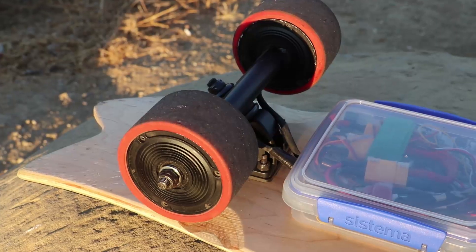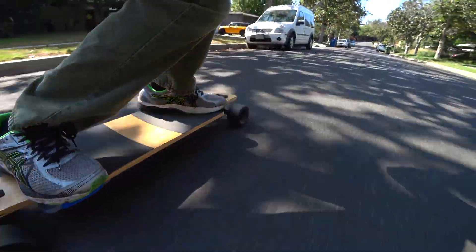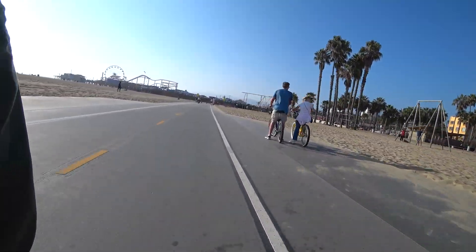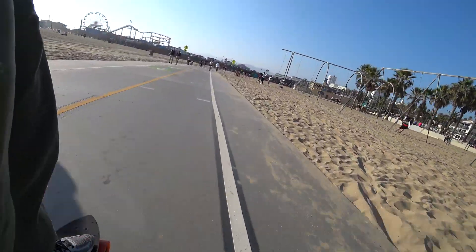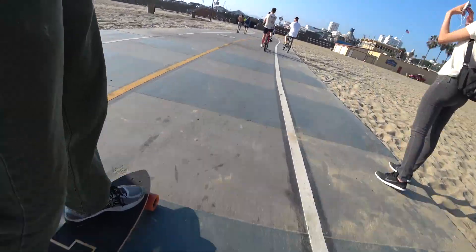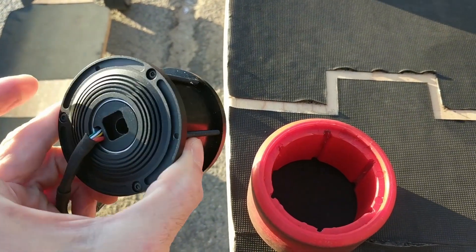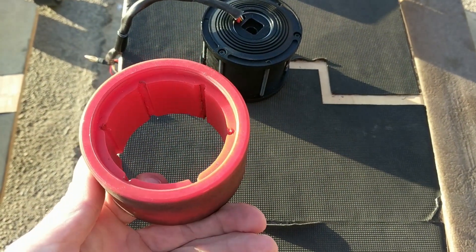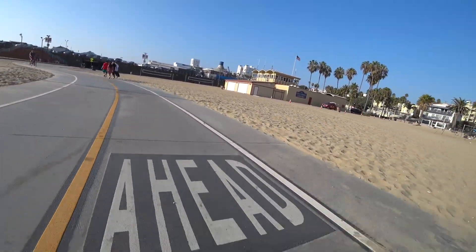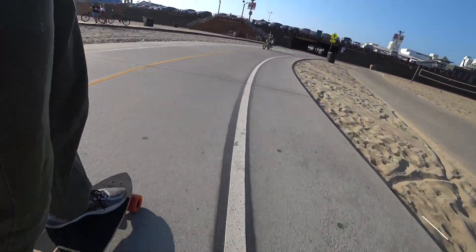There is definitely room for improvement. These motors are light, but they do struggle a bit on steep hills and tend to heat up. After riding my 10S longboard with the 90mm motors, it does make me think twice about an upgrade. I'm not sure I'd recommend the motors I'm using on this board because, in my experience, they only support up to 8S voltage. I tried running them at 10S using the VESCs, and one of the motors burnt out after just a few minutes. They might work okay using the cheaper dual ESCs, or if I adjust the VESC settings to reduce the max motor current. The first thing on my upgrade list is to keep an eye out for better motors — maybe someday someone will make super light titanium motors with copper heat sinks, but then they'd probably cost a fortune.